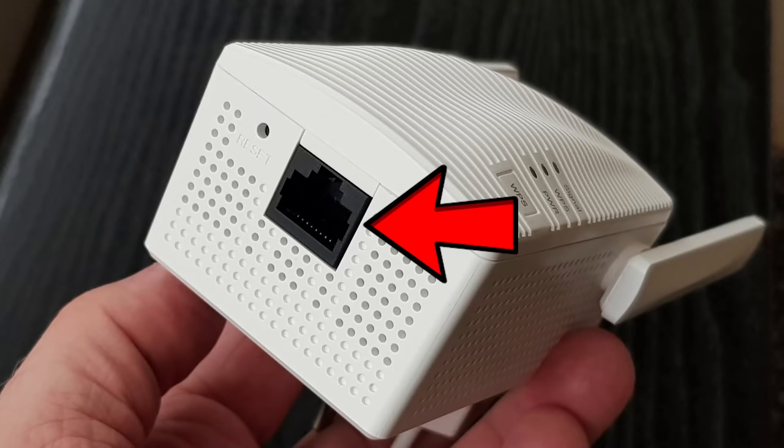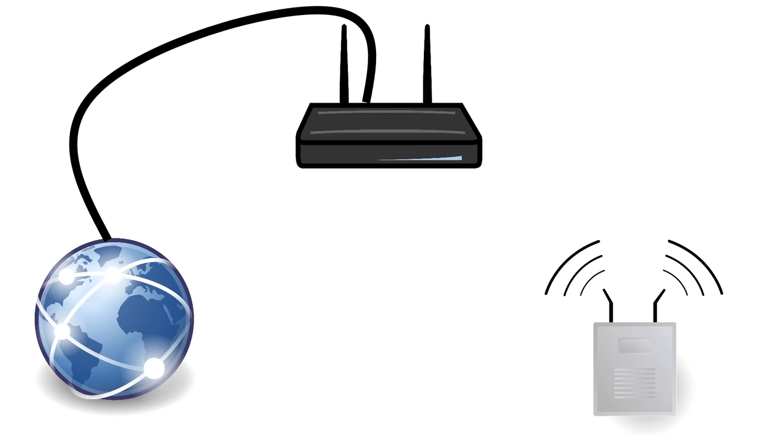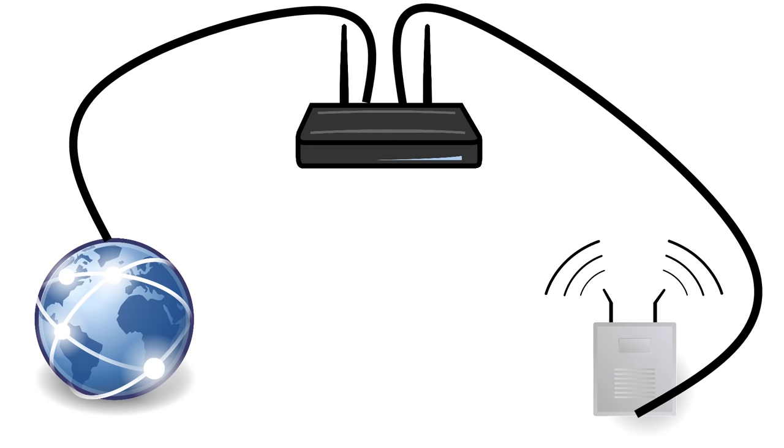So how does that work? When you connect to it using an Ethernet cable, there is a configuration you can do — and I'll show you how to do it on this particular model in a moment — where you can turn it from a Wi-Fi extender into a Wi-Fi access point. That means what you're really doing is creating a new Wi-Fi network somewhere else in your house or property, and that network connects over an Ethernet cable to your existing network.